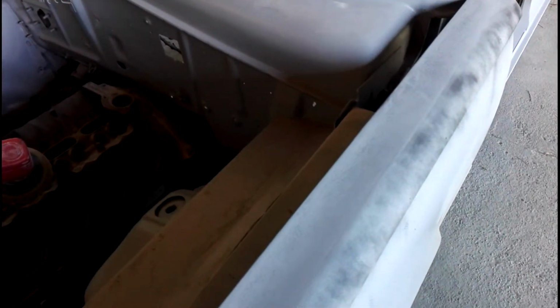You can see in here too, I've got a bit of filler. You can see the ring around it a little bit, and in here where there's bits that are low. So I'll turn this off now, and I'll keep blocking and see if I can get this real clean and see how we come up. So you get a general idea there. You do a couple of passes one way and then a couple of passes the other direction with that X pattern of sanding. So I'll pause this and we'll come back to you in a couple of minutes and give you another good shot of that.